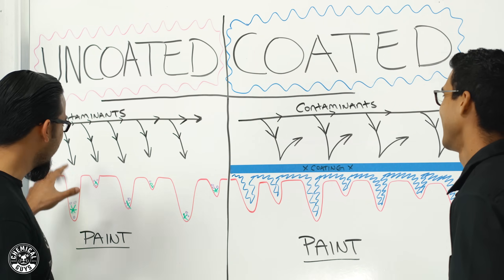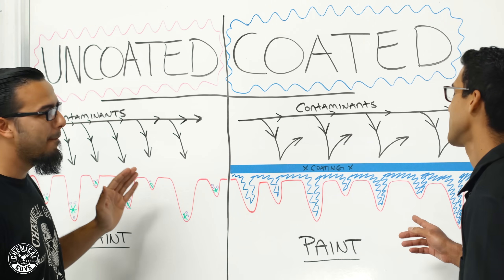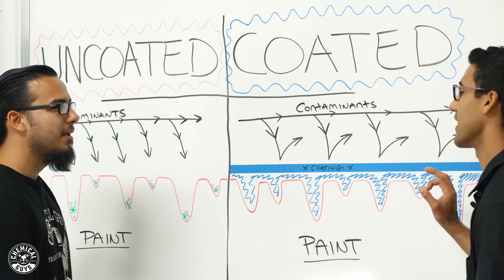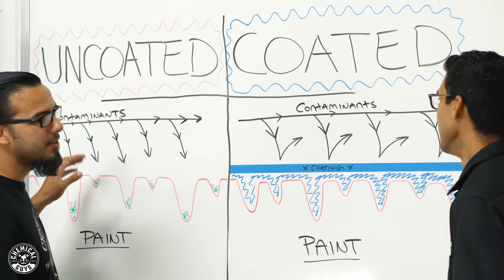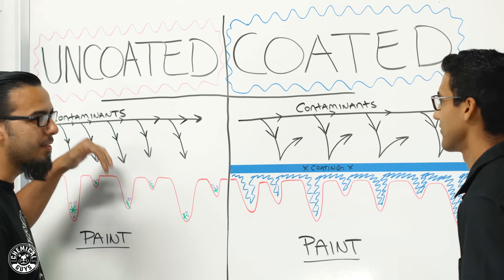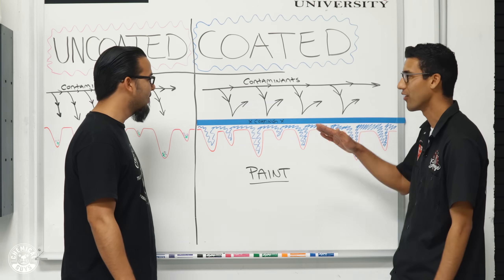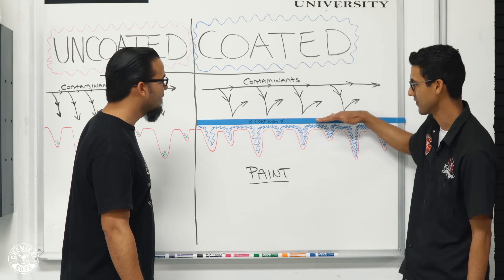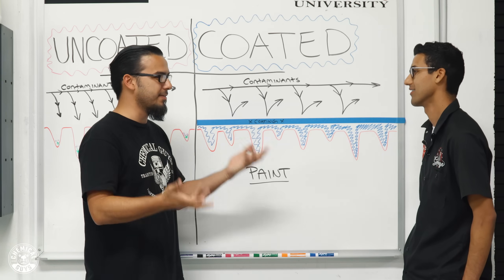So I can see here that you have small imperfections — scratches and swirls on a horizontal plane — and you've got contaminants in there too. The paintwork is actually uneven, not just scratched and swirled, because we're looking at a microscopic level. People think it's smooth but in reality it's not, no matter what. Even with wax and sealants, they're not going to harden on the surface — a glaze isn't going to fill in a deep scratch. Waxes and glazes follow the surface undulations, but a ceramic coating actually creates another layer on top of that porous surface. That's what gives you that extra shine — you now have a smooth surface that enhances the look of the vehicle.